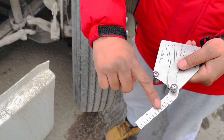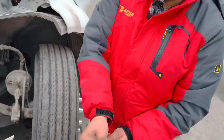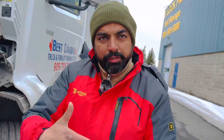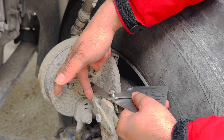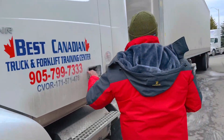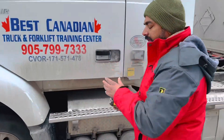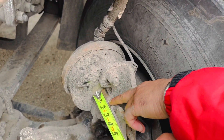Using the measuring tape: this is 1 inch, this is half inch, and this is 1.75 inches — that is the limit. The push rod must come out under the limit. You can see the white chalk mark is parallel to 1 and a half inches. The limit is 1.75 inches, but the push rod only came out 1.50 inches — so my brakes are in adjustment.